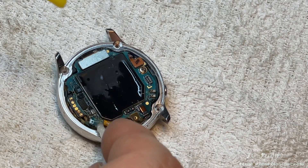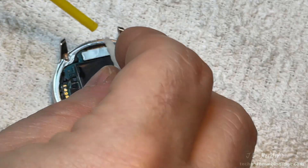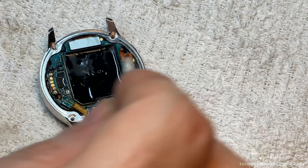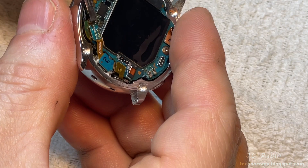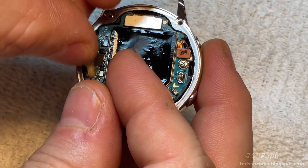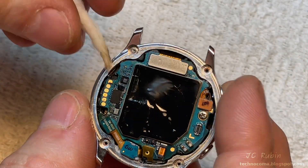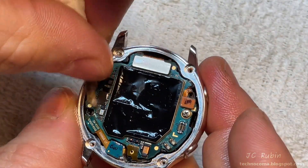More work on the main board — hitting each connector again with capillary action to make sure the connectors underneath get wet. There's a big connector up top; I hit that top connector once more and go over everything. After letting it sit, I pop off the first connector without incident. More DeoxIT is applied under the connector now that it's removed. This header looks really bad but surprisingly cleans up pretty well — I'm using a paper towel and can see all the accumulation coming off. The board is bad but at least it's cleaning up.